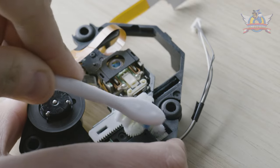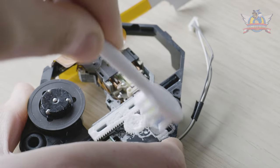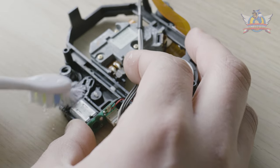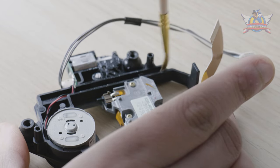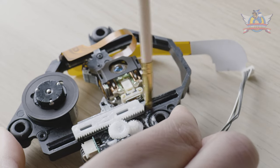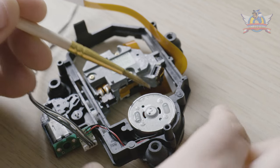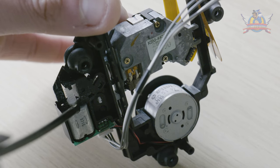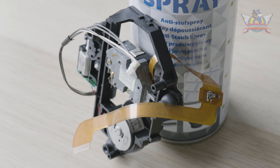While that's going on in the background, I have the time to fix the lens in the meantime. I want to thank Josefine for pointing me in the right direction towards a guide from Alex — I have the link to his guide in the description below. First I clean the gears with a toothbrush and soap to remove any leftover old grease, then clean out the lens rails with soap as well. I then lubricate the bigger gear motor with silicone spray, making sure the grease gets inside the motor by pushing it into the holes. I do the same for the other motor spindle on the side of the lens. I then let the lens unit stand vertical for half an hour to let the grease do its work on the inside.